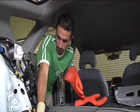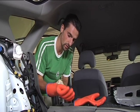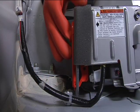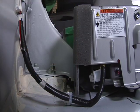Right now I'm going to take out the orange Prius service plug, and it's important to wear these safety gloves to protect yourself from the high voltage in case anything goes wrong. It's pretty simple — just clicks up and out, and it's off.